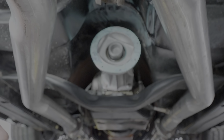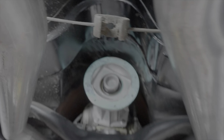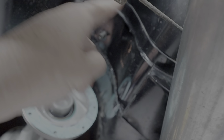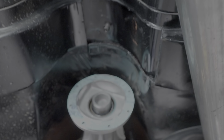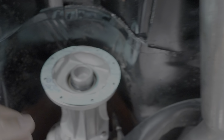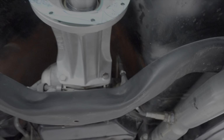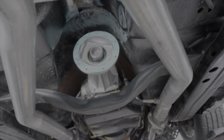So now we've got the proper clearance, and we can now hoist up the overdrive unit to see if it fits. We've clearanced all in here, and hopefully we've got enough room. If not, it may be beating the floor. We don't know yet. So we're going to attempt to drop this in, and if not, we can drop the transmission down just a little wee bit and take out a spacer here in the transmission. So we'll get this pushed up in here, and we'll be back in under here.